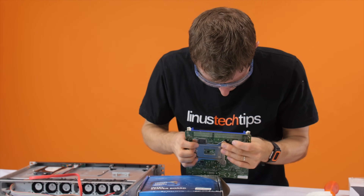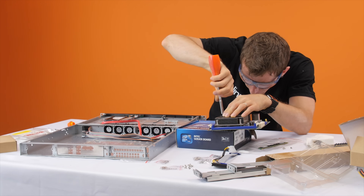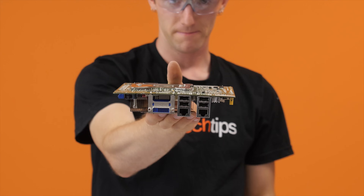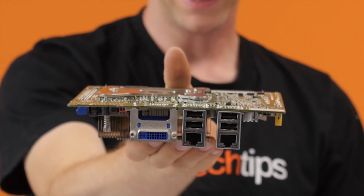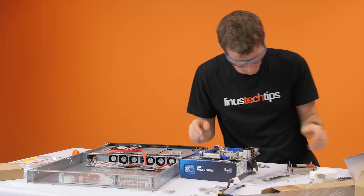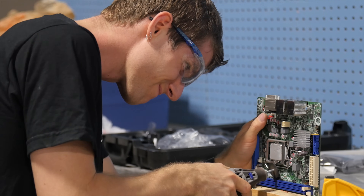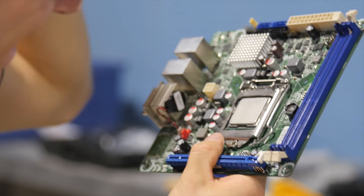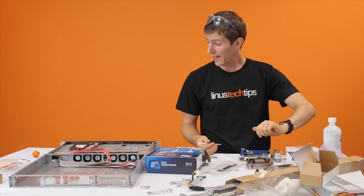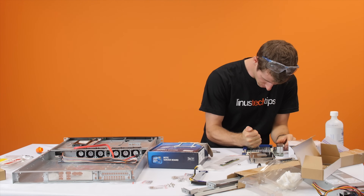The speaker's okay, but that bit next to the pins has to go. This is intended to sit right flat against the back of the board, but there are quite a few things on the back of this board. We might just barely be able to screw into that back plate. There's a fair bit of flex on the board, but nothing deadly. I think we should just hack off the top of this speaker too — it should be enough to get the job done. I just don't want those pins to touch. We've been at this for like an hour and we've installed an IO shield, a CPU, and a socket. I haven't even managed to put a heat sink on.